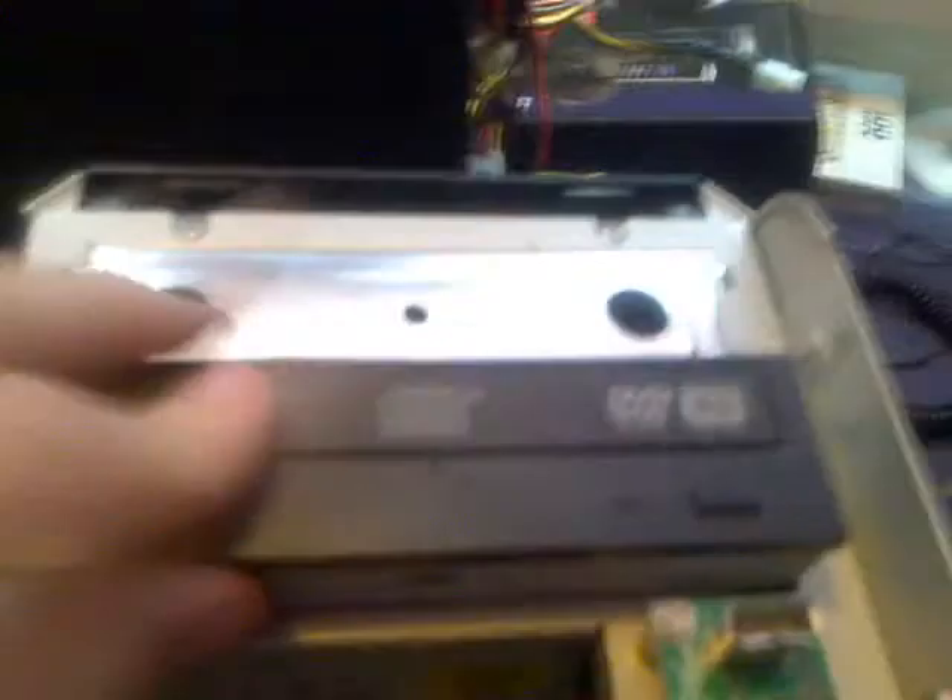Now it's got the front of the tower. I'm going to turn it on its back — so now you can see the top of the front of the tower. We're going to pull this piece up. Now you can see the internals of the actual tower itself: you've got the DVD drive at the top, all this ancillary rubbish, your power switch, the lights — all the bits needed to make this function. There are holes in the front of the tower called bays, and we're going to use those bays to house drives.